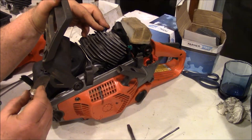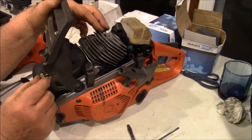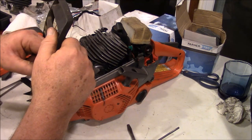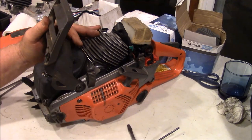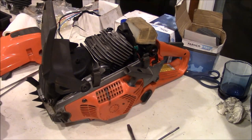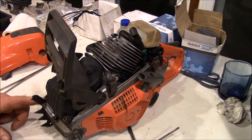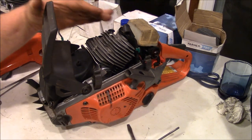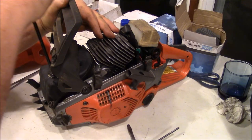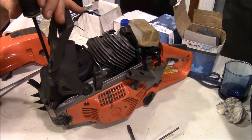Of course, I made all this big deal about putting in the screen muffler. Might as well do it, huh? When you're looking at the pile of screws that you might have left over from doing a project like this. On this saw here, there's going to be three small screws. One that ties down that series of ignition wires. Two on the plate over here, the guide plate, cover up the oil pump and stuff on this side, and three, this one.